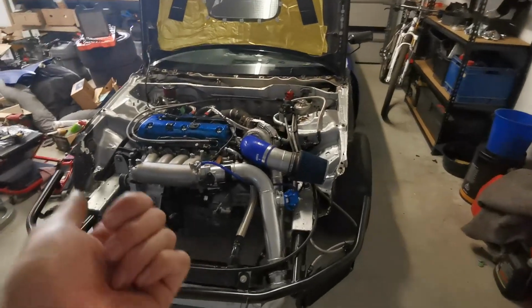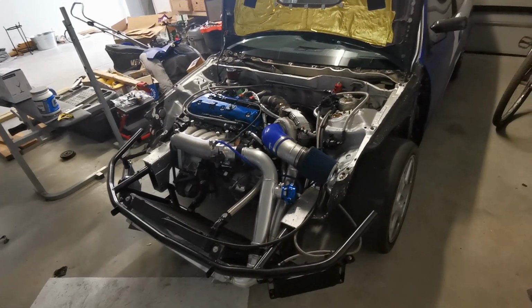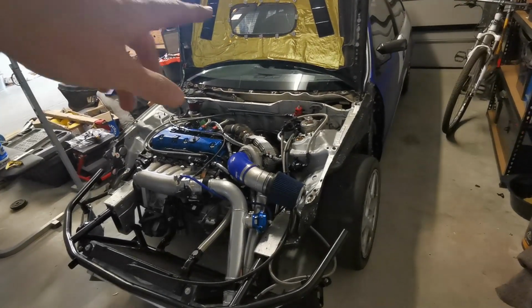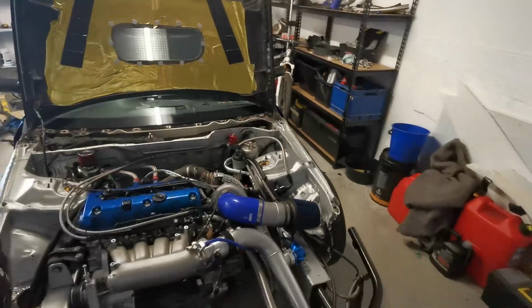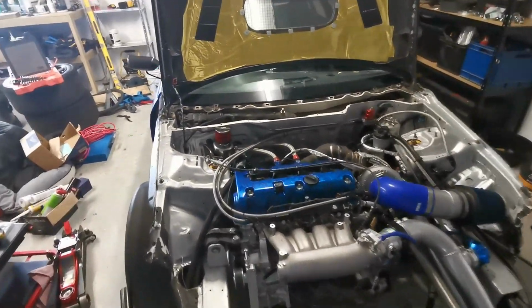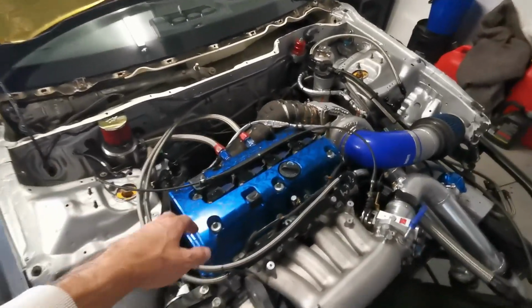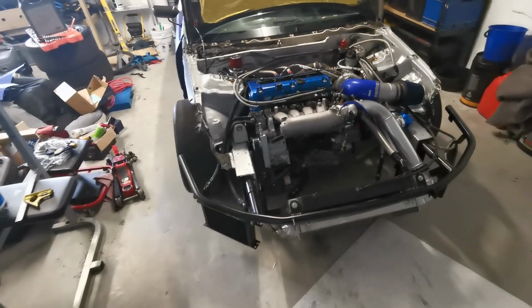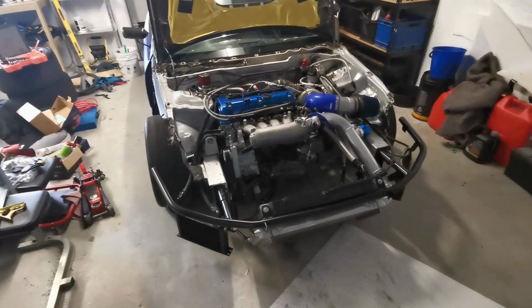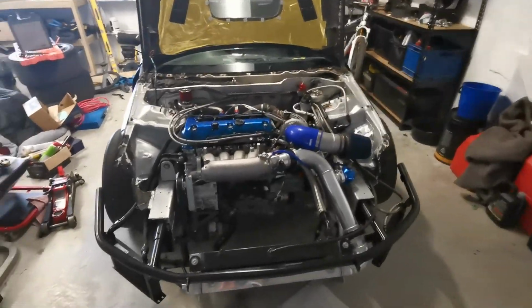Yesterday it fired up for the first time, which is really cool. She's come back to life. A bit of bleeding on the water radiator to do, and there's a power steering line leaking somewhere, and it's just got some stock spark plugs in which need to be changed out, but it's okay just for running now. In 3 days time it's going to dyno, so I'm just going to get some bits and pieces done now.